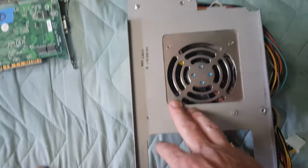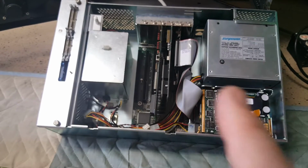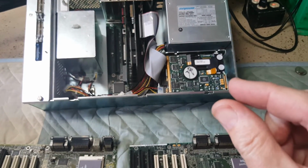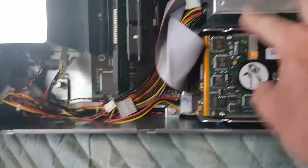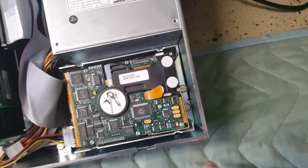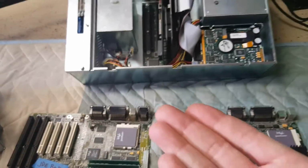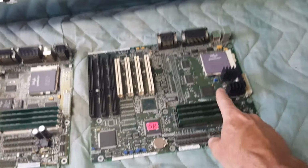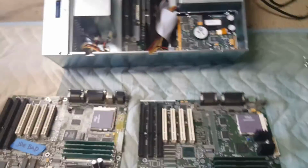So I figured, well, maybe it was shorting. So I actually measured the clearance that was happening. And again, since this is a slightly different design, the clearance was just a little bit smaller than it should have been on what it is in an existing box. So what I did was I added spacers underneath the captive screws of the power supply unit. So there's spacers here and underneath this screw that actually raise up the back end of the power supply just slightly enough so it clears this heatsink, so it no longer shorts this heatsink out. So that was the solution.